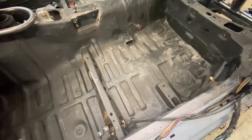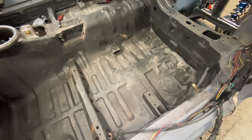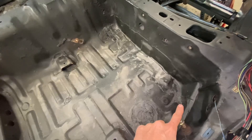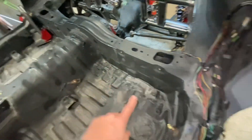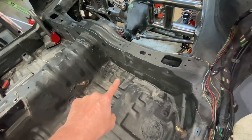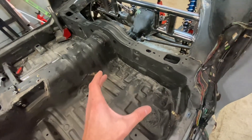A lot of guys, what they'll do is they will run it underneath the car. With doing that, you also have to have a number one bar that goes over the tunnel or under the tunnel — it does almost like a driveshaft loop — but that's where your main hoop would come off of as well. There are also some other bars for the funny car cage for the driver compartment, the containment for the driver.